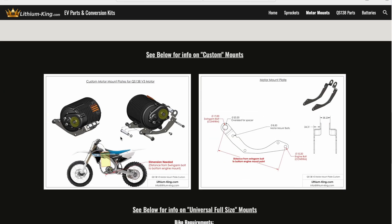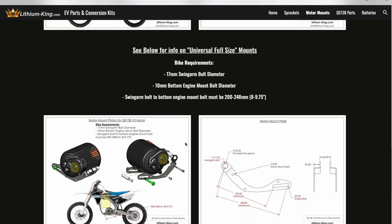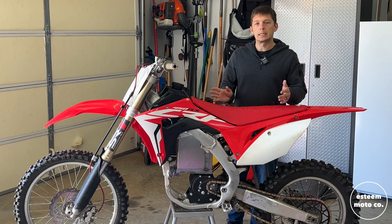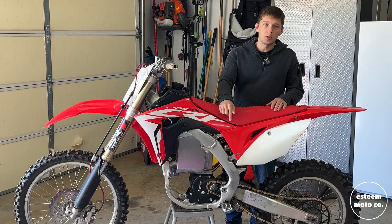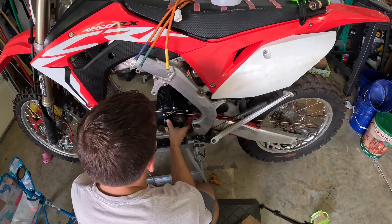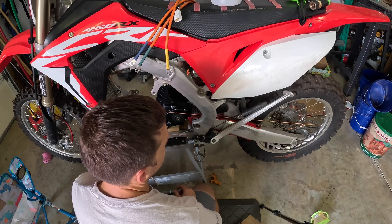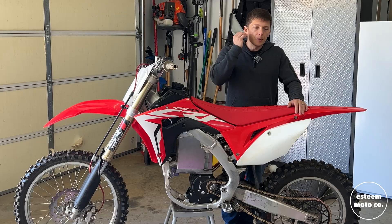I hand-fabricated all of that, broke a lot of welds, and scrapped a lot of metal — that was part of the process I wanted to do. But moving forward, if I just wanted to get it done, I'd go with the pre-made motor brackets. You still have to mount your battery and controller, but that's quite a bit less work. The big thing is those metal motor brackets will actually align your sprocket, which is extremely important — getting the sprocket height correct, the distance from the swing arm correct, and aligned so your chain runs in a straight parallel path to your rear sprocket.